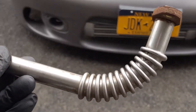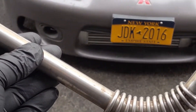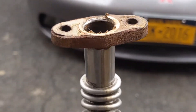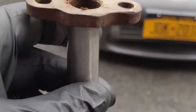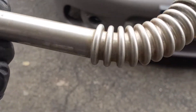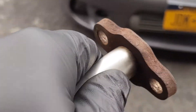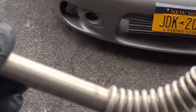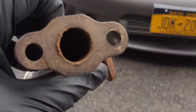I'll show you guys how you can use a nice aluminum 2G-style oil return on a 1G turbo. The pan is actually flanged the same on this end - the only difference is the flange going from the turbo itself. There's some old gasket on here I have to take off, and obviously this is the one you'd want to use regardless because it's made out of aluminum - no rust. I'm going to clean this off with a wire wheel, get the gaskets off, drain the oil since she's due for a change, and replace the oil filter.